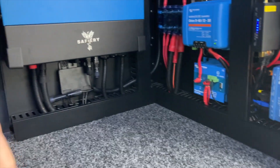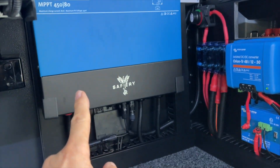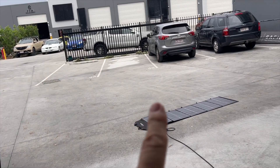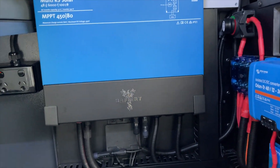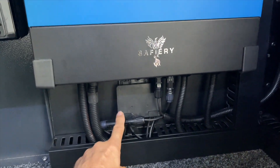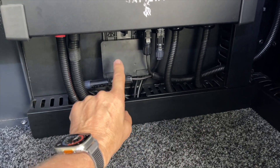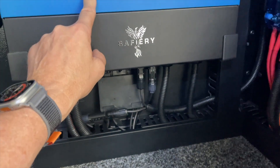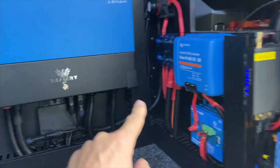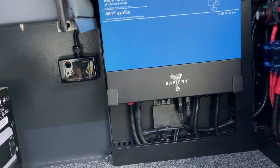The thing we've done here that I think is good is that we've got the RS6000 here. And there's the solar blanket out there — it's pretty overcast at the moment. But we don't need another solar controller for it. There's our DC-to-DC for solar. All we simply do is bring the blanket into the DC-to-DC for solar — it increases the voltage, brings the current through, adds that on to what's already on the roof. And that gives Daniel plenty of power.